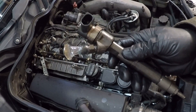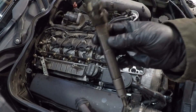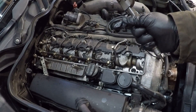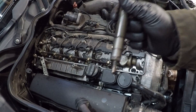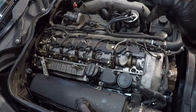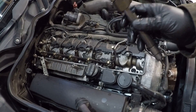This injector from the dealership is around $500 to $600, and you can get OM648 injectors online for around $350 to $450. But OM647 injectors you can get for around $150, and they are identical to this. They have a different nozzle part number, but if you calculate the horsepower rating for the OM647 and compare it to the OM648 dividing by displacement per cylinder, it has an identical horsepower rating per cylinder, meaning the fuel flow rate is identical. I've been running an OM647 injector on this car for about three years on cylinder number six and it's run flawlessly, so go ahead and check OM647 prices next time you need to replace an injector — you may save a significant amount of money.